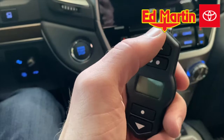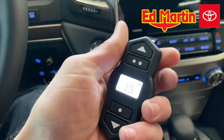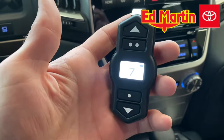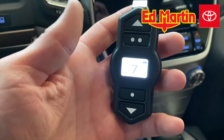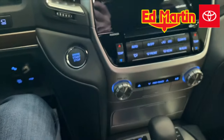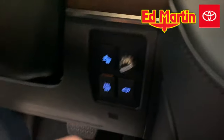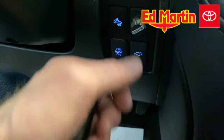The airbags are controlled through an AirLift wireless controller. Right now they're set at 15 PSI. If I wanted to bleed down to as low as 5, just basically set it to whatever you want and the car will just bleed down — it's super quiet. Likewise, if you wanted to increase the lift in the rear, just basically set it to whatever your desired level is, let go, and it takes a second and it'll turn on. There's the compressor turning on for the rear airbags.